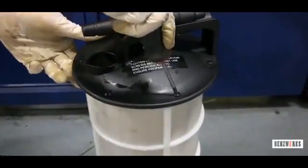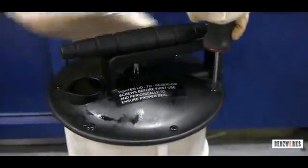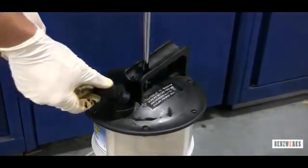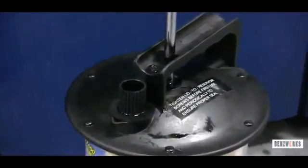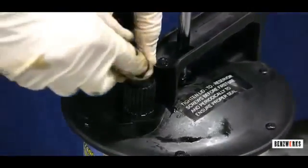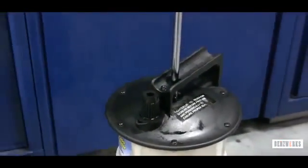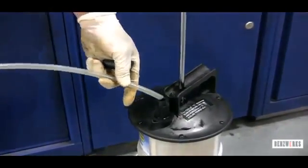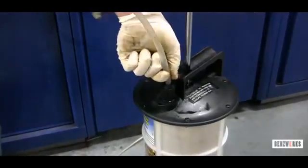When you first buy it, you take it out of the box, and the label tells you to tighten the top screws, because there's a seal there and you want it to be tight so you get a nice vacuum to suck up the oil. Get this little coupler, stick it on there, and then there's this rubber grommet. You put that on, and then the kit comes with 3 hoses. Start with the thicker one and place it in there. It's going to pretty much stop.